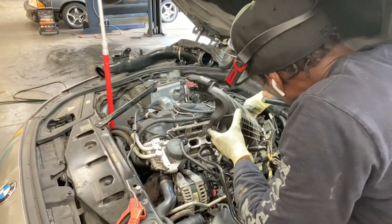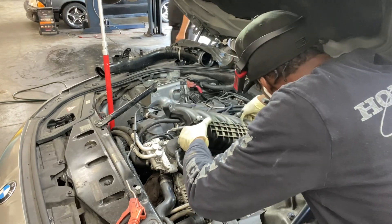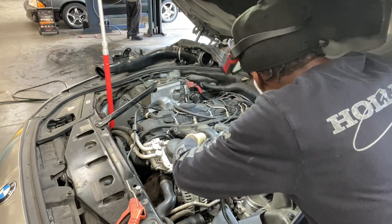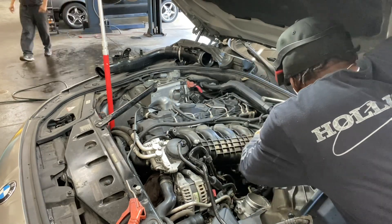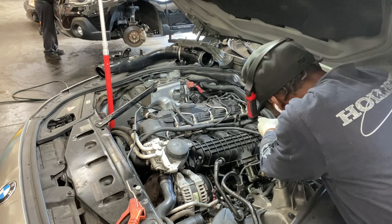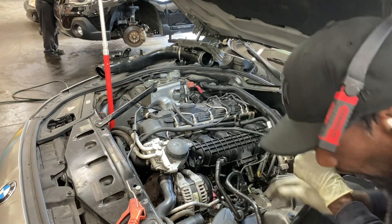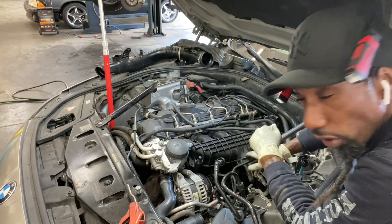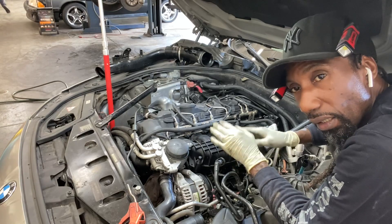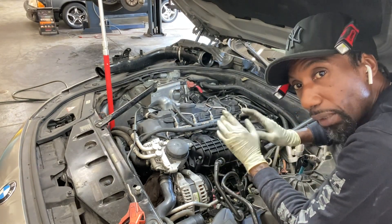It's a beautiful thing. All right, I'm going to put the computer back on the machine — it seems like the smart thing to do. Let's make sure that's all. We have no loose wires back there, everybody comes in the top. Get your 11 millimeter with extensions. Put all your wiring back down the bottom here, plug back your computer, all the stuff that goes behind the throttle body. That's your next step — to put the throttle body back into place.